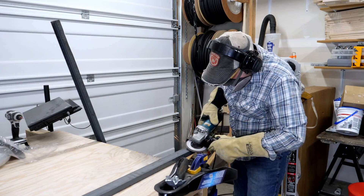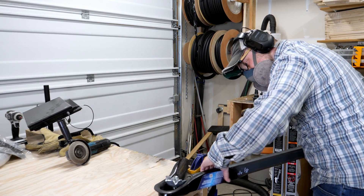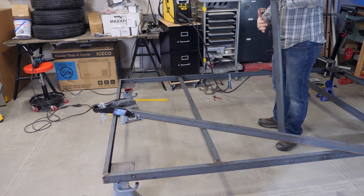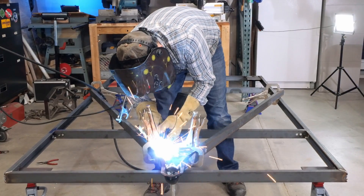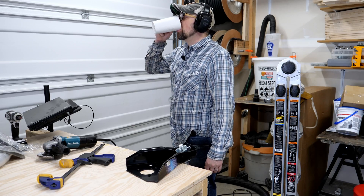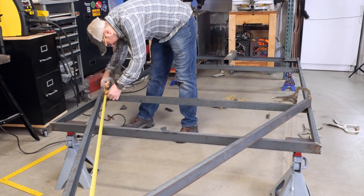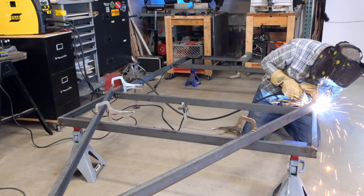I profiled the pieces going into the coupler so they match the curve of the inside a little better, then used the angle grinder to grind off two welds that stick up too high on the bottom of the frame where the tongue will be mounted. With the tongue laid down on it, the frame basically works as a fab table — I just clamped it all down and started welding. One thing I missed was removing the giant 'Made in America' sticker on the coupler, so while welding it caught fire and smelled terrible. After a smoke break I welded the rear, added brackets to the bike rack area, pushed the tongue into place, aligned everything square, and dropped a few welds on it — scattering the heat to avoid drooping at the front.